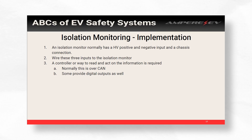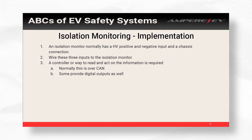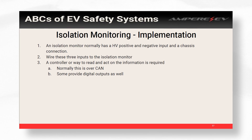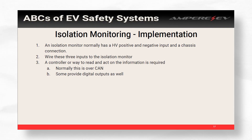Basically there are normally three connections you make: you connect to the high voltage positive, negative, and then the isolation monitor connects to your chassis. Once you have those, it can report the isolation either over CAN, some kind of communication network, or it can even provide digital outputs so you can turn on some lamps for the driver.